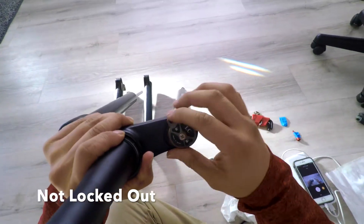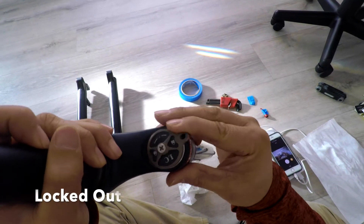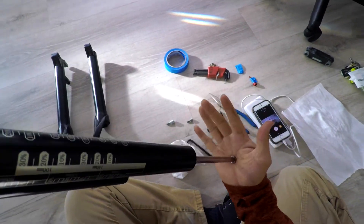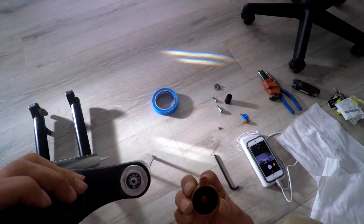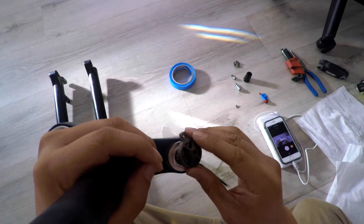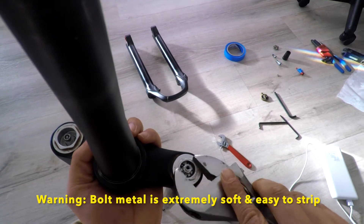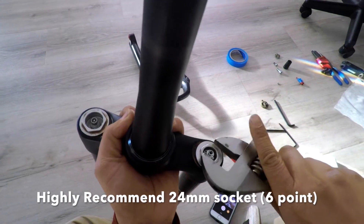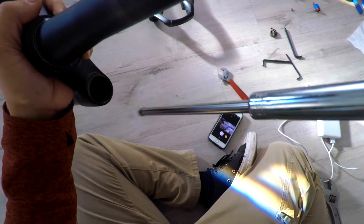You can see when not locked out the damper shaft moves, and when we lock out the fork the damper shaft does not move. After removing the cap you'll see a hex socket used to adjust the lockout. To remove the damper — big warning here — the metal is really soft and I almost stripped it using an adjustable wrench, so I would recommend using a 24mm 6-point socket instead of a 12-point, because the 12-point will likely strip the shoulders right off.